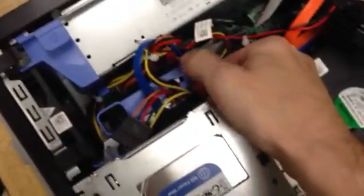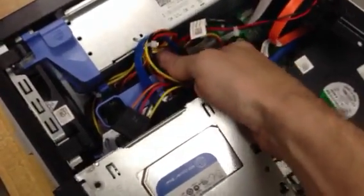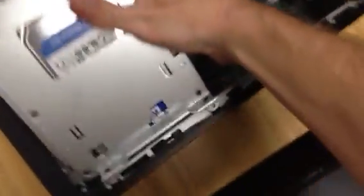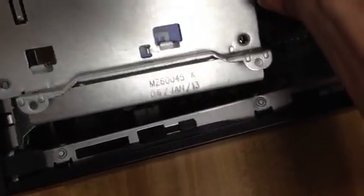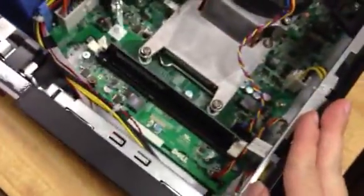The only thing that's going to stop you is this bundle of power cords — push right past that. You'll see these little notches right here that go into some posts. Carefully lift off of that, lift this over, and you have access to your RAM slot.